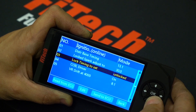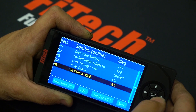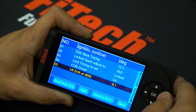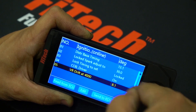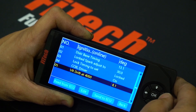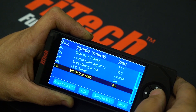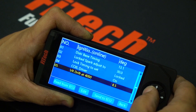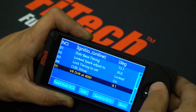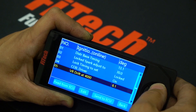Another thing we may want to check with this locked is when we rev the engine to say 4000 RPM — does the timing stay at 30 degrees? If it doesn't stay at 30 degrees, we can advance or retard the high RPMs so that it also reads 30 degrees. Typically, 8 degrees is enough to compensate for standard distributors.